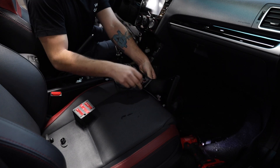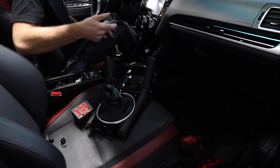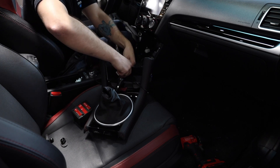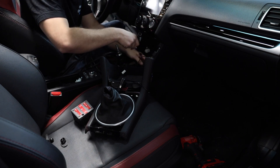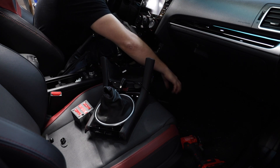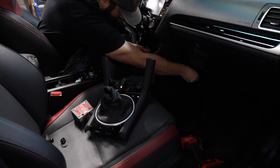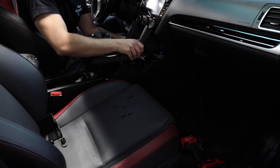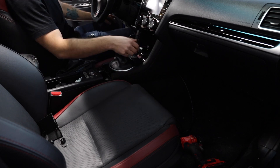Like I said, if I don't have the right tool for a job, I'm going to make it work — and look at that, we made it work! So our wiring comes through there. I need to do power to one side and then the sensor to the other — signal one side, power to the other. The sensor wiring here I'm going to have protrude down the side of this and we're going to run it behind the glove box, kind of like we did for that dash cam wiring. Then the power wires are going to come out the other side. Power and ground going off to the driver's side, signal and sensor going off to the passenger side. You can't even see the hole that I drilled back there, which is good.